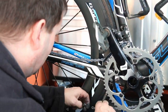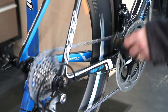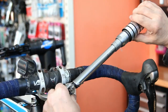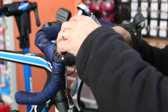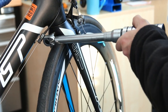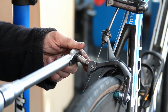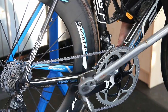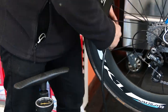Once we've rebuilt the bike and indexed the gears, we begin to go through the bike entirely front to back. We always give a service sheet with every bike we service, and we torque everything up to manufacturer specification — literally every nut and bolt on that bike is checked. Even the brake blocks — every single bolt is done to manufacturer specification and I write all of those down on the service sheet. It makes a vast difference to know you can confidently get on that bike knowing it's been checked 100%, with no margin of error.